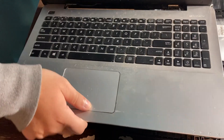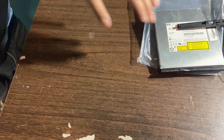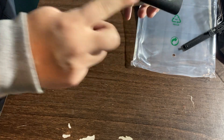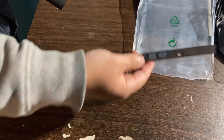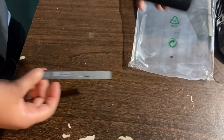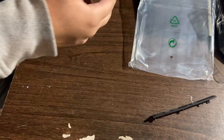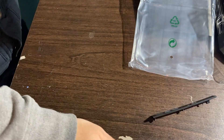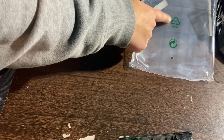One thing you need to be aware of is that not all laptop DVD drives are going to be the same — specifically the faceplate. The faceplate may not fit with the faceplate that comes with your external DVD drive enclosure. So make sure the faceplate fits your DVD drive, because not all DVD drives are the same. Let's take out the original faceplate like this.